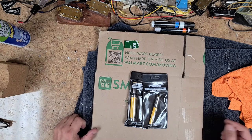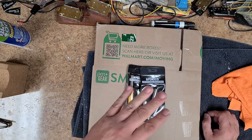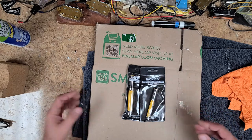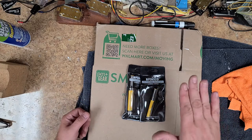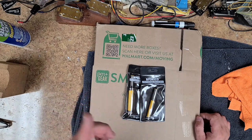Thanks for watching, guys. Hope you guys learned a little bit on the sanding procedures as far as the way you use your hand on the sandpaper and the direction you go reflects how your finish is going to look. If you get it in a certain type of light after buffing it out and you see that it's a little bit on the wavy side, well, your hand or your block, however you were sanding it, has a lot to do with that.